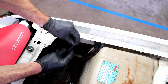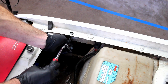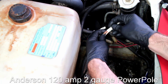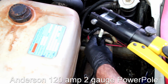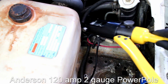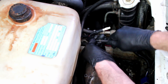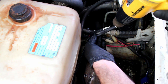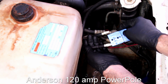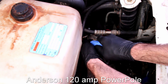Attach the new ground wire to the chassis. The two wires are inserted into the 2-gauge power pole terminal and then crimped down. The negative terminal gets the same heat shrink job as the other side. Now it's time to connect the power pole — each side has a labeled negative and positive. Do not mix them up. Push each terminal into the connector; you will hear and feel a click, and that's it.